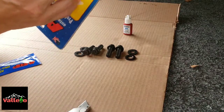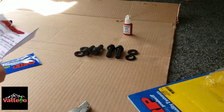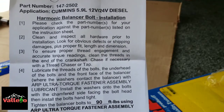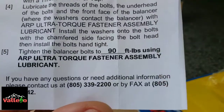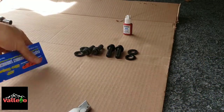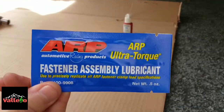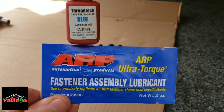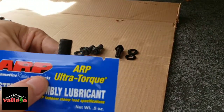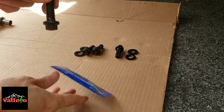There's actually instructions in here. Please check the part number, clean and inspect, use ARP lubricant, torque to 90 foot pounds. I'm going to do a double precaution — some loctite with a little bit of ARP lube. I'm probably going to put the lube on most of the threads and the loctite on about that much.